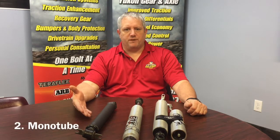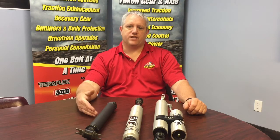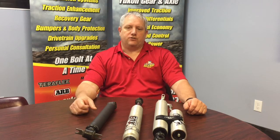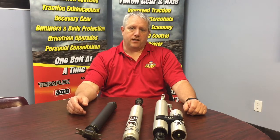The next shock is what's called a monotube shock. This monotube shock is exactly what it sounds like — there's one tube that holds the oil and holds the nitrogen charge, with an internal floating piston that separates them. This shock is going to have about 200 psi of nitrogen charge. Then the other common shock is your reservoir shock, which is almost exactly the same as the monotube, just with more room for oil and nitrogen. It'll run a little bit cooler, and extended performance is really where that shock is going to shine.